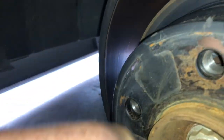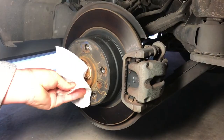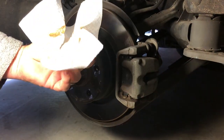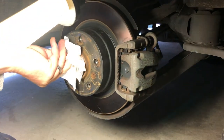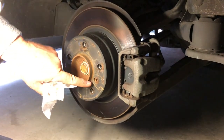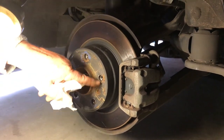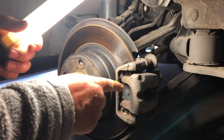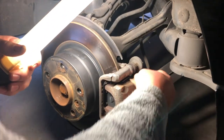I'll give it a rub on the inside as well and then paint it to stop further rusting. You can see the powder sitting there — just get a paper towel and wipe it off. You don't want that if you just sprayed paint straight on — all of that would end up in the paint. You can see the amount of dust that came off with just a really quick sand. If you've got rust around any of the other parts — particularly this bolt when you're replacing the rotor — do that as well, and the caliper too. You need to key the surface with rough sandpaper so the paint has somewhere to hang on. The more prep work you do, the better the job.